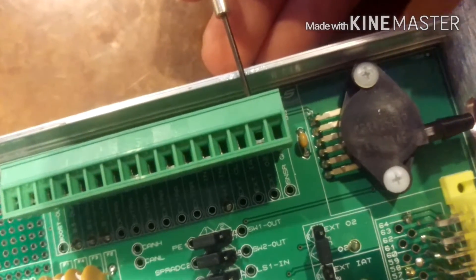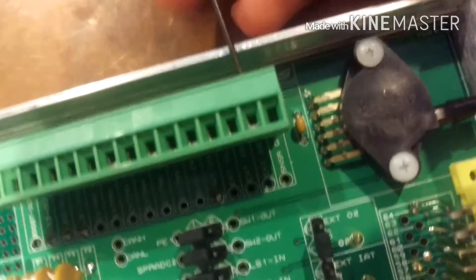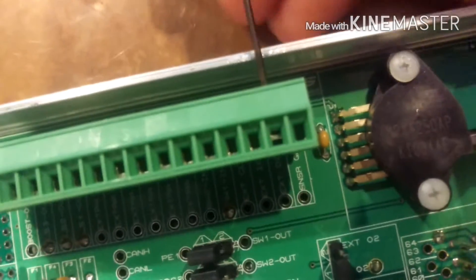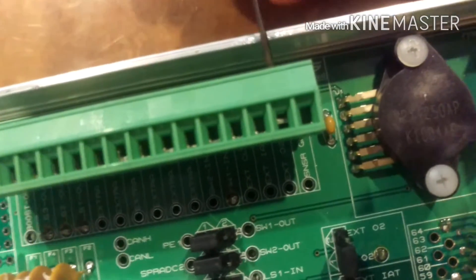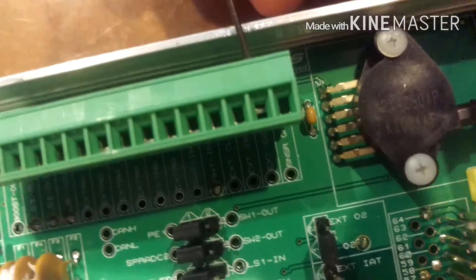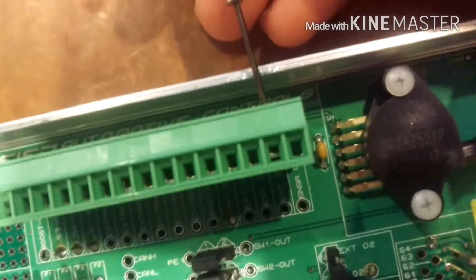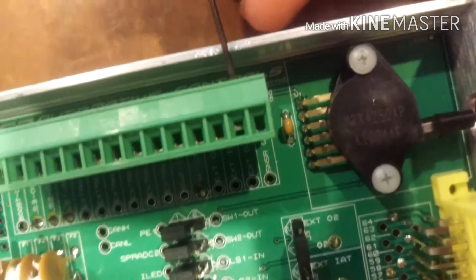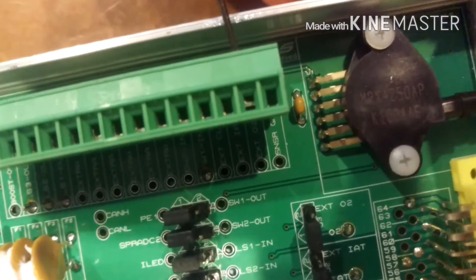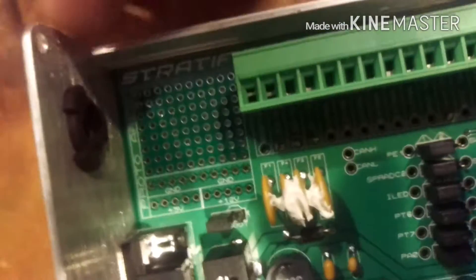This one that I'm manipulating here — you're basically going to put the wire into that little slot after it's stripped, and then tighten it down. That is for the extra O2 sensor, so you're going to put your wideband O2 sensor signal wire in there, whichever one is designated by your wideband. Then crimp it down — that's the easy way to connect it. Make sure to run it through that grommet so it comes out the side.